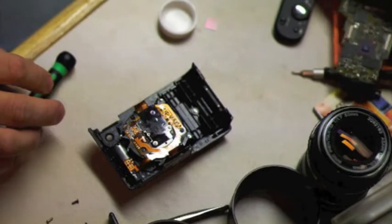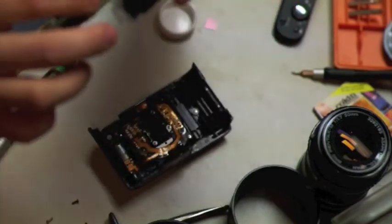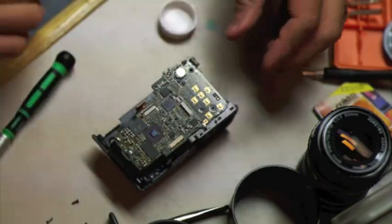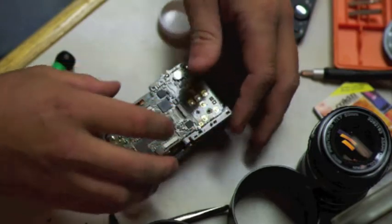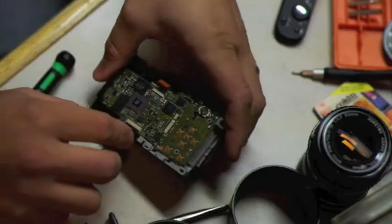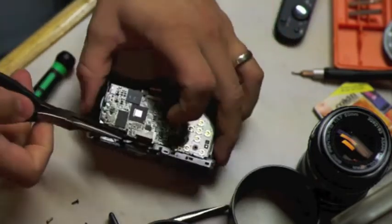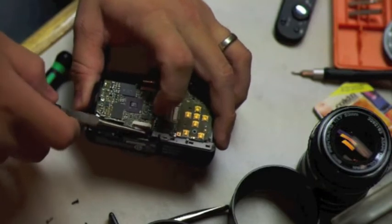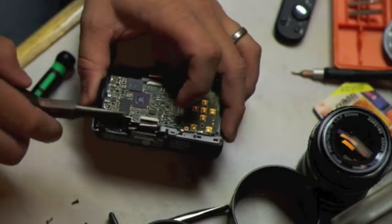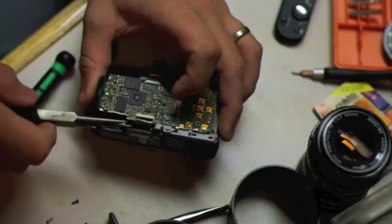The hardest part of the job is coming up, and that's getting these two ribbon connectors back into the card, because you can't put them back in until everything is set fully in place. It's possible I'm not doing this totally the right way — I don't have a service manual or anything. So what you do is stick that down in there. This other one wants to flip back up and you can't get it into the slot, so you might have to use the needle nose pliers, loop them around, and kind of bend it over, being careful not to pull on it until you get it into the slot.